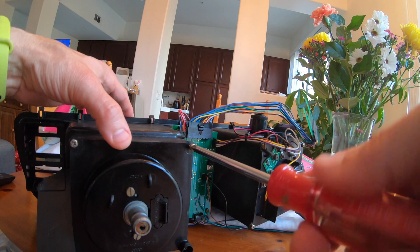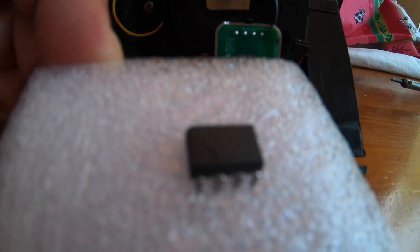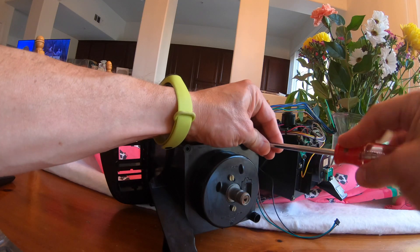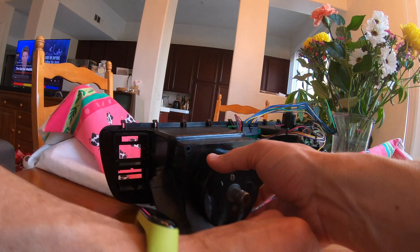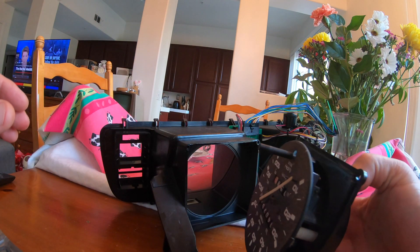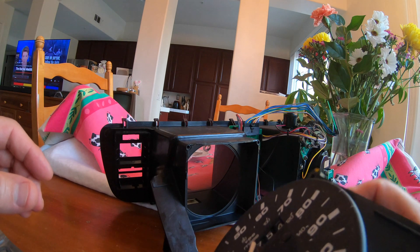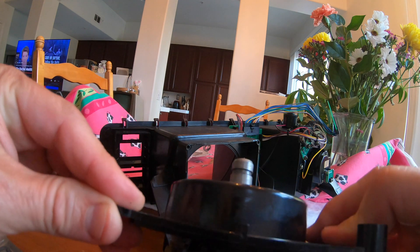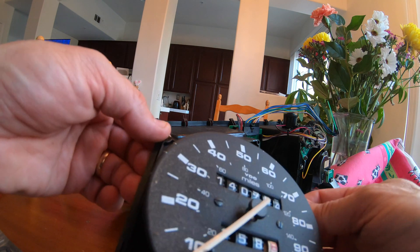I hope this helps somebody. I will leave a link to the part and also show you the cleaning and everything else that I did. It's just four screws that hold the speedometer in, and once you remove those screws, the speedometer just comes right out. You're then able to clean the inside of that window — it's so nice to gain access to that. I had a lot of dust on mine, so I ended up cleaning that off as well. It's not as scary as it may seem.